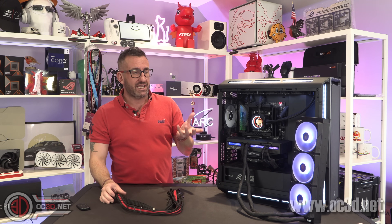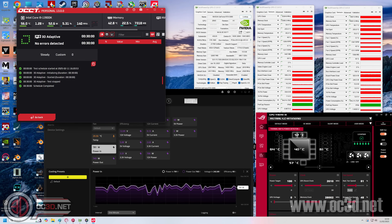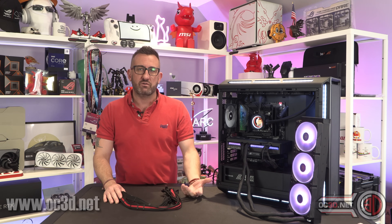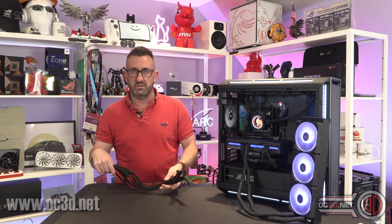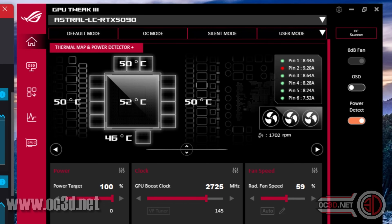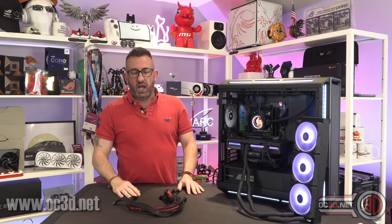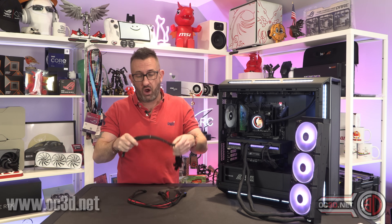But things changed with the Astral, because it quite comfortably pulls 600 watts for fun. I've had it pulling more than 600 watts, which was one of the things that alarmed me when I started testing it. The system normally pulls around 800 watts, but suddenly it was pulling close to 900 watts — because the cable had been carrying over 650 watts. And this is where it gets interesting: the ASUS software has a new feature that monitors the cable load, and it started going red. It goes red because the load is unbalanced across the cable's conductors. When they get unbalanced it goes red and alerts you. At that point I thought, okay, I've reached the end of the usable life of my cable — it's clearly had a hard life — so I'll swap in another one.